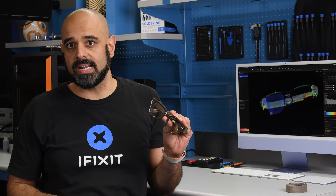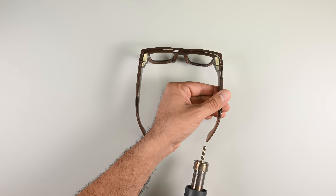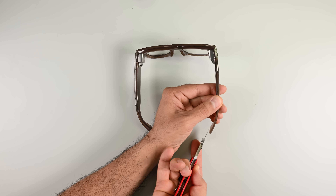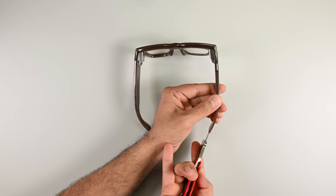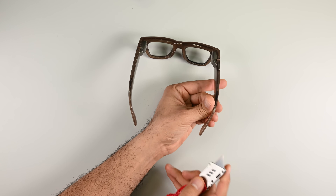So let's jump in and take a look inside. A common design platform has advantages for repair nerds — my experience opening up the last two generations of smart glasses shows exactly how to get into these ones. Starting with some heat on the thinnest section, I can split the two halves of the battery arm with my shiny red limited edition JerryRigEverything knife.